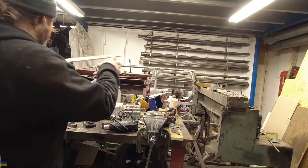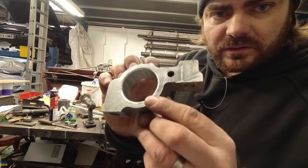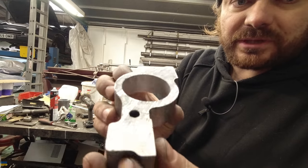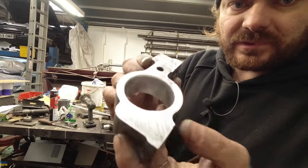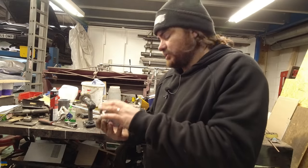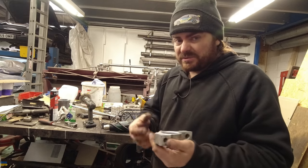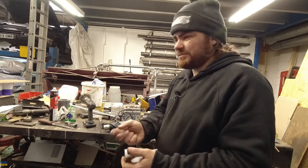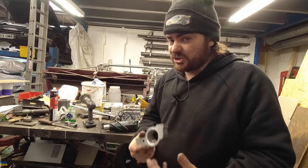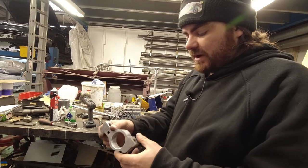The bushes are now in boiling water. I've filed down the edge of the housing and rubbed it down — normally it would be a sharp edge, but I've given it a little radius there just to help it not rip the bush to pieces when I push it through. I'm going to try pushing the bushes in as they are. It's possible it compresses that much — it seems a long way to go, but I'll try it as-is. If it's just not having it, I'll resort to trimming the bushes down — but I've got to try it this way first.